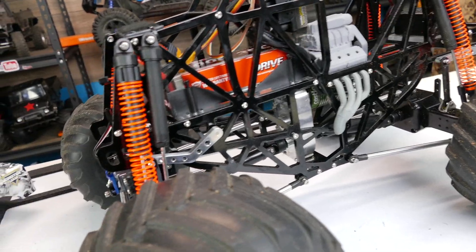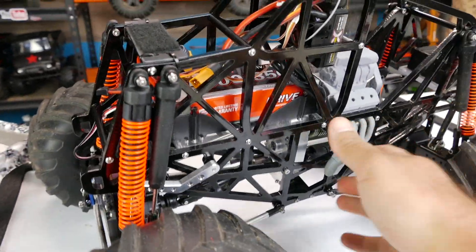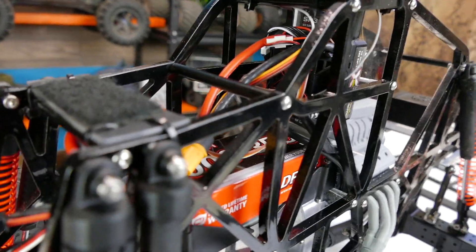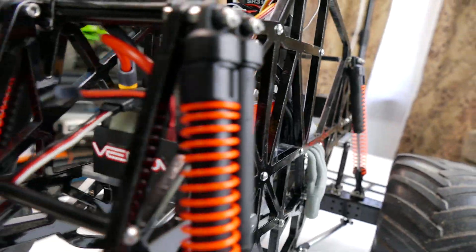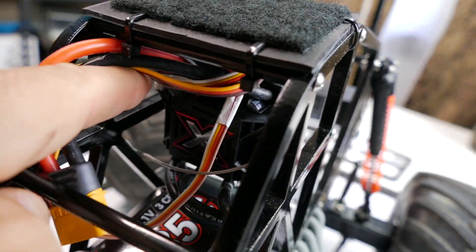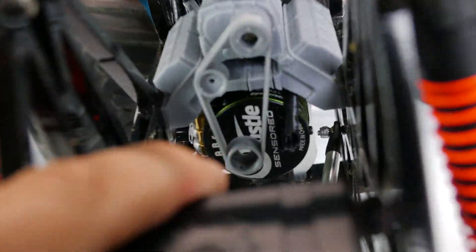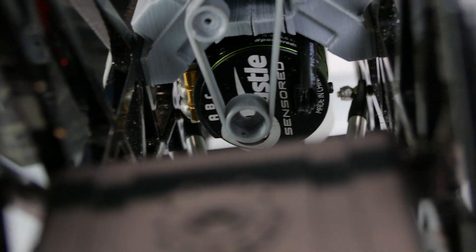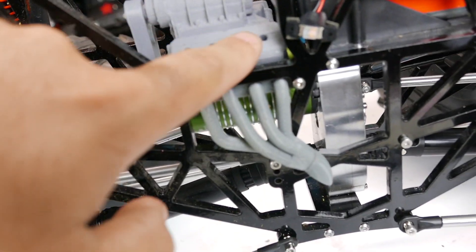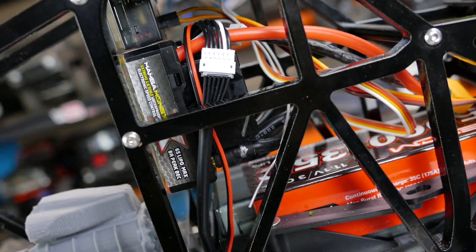The chassis came as is. I'm running a Venom Drive Battery, 35C 3S, 5000 milliamp-hour, hooked up to my Mamba Monster X 1/8th scale ESC — it's way in the back and hard to see. I haven't fully finished wrapping all my cables. It's sensored down to our nicely hidden Castle motor, which is a 1512 2650KV four-pole sensored motor. I ran the sensor wires tucked under the 3D printed motor mount, coming up behind my power switch and into the adapter that goes into the ESC.